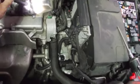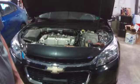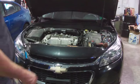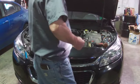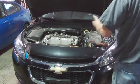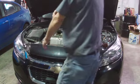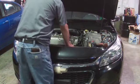We're going to do 1 and 4 and see if we see a change in valves. Clearly the engine's not going to be running right because we're going to have a dead cylinder while we're running this test. Hopefully it doesn't kick us out of the test, because I want to see that it'll move, and then pull the valve cover to look deeper to see if we have rocker damage.